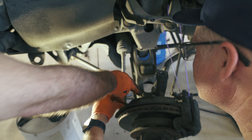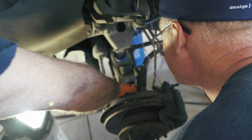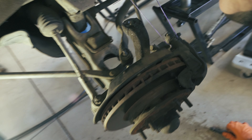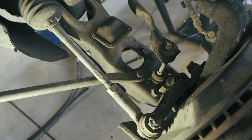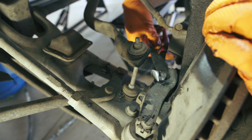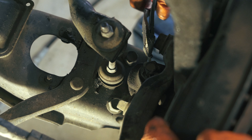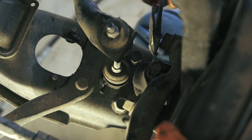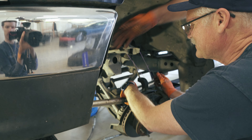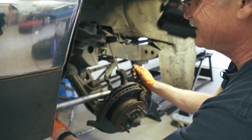Let me get an extension. So this arm is attached and has a spindle going through it, but it's really tightly wedged in there. We have to use these forks to separate it and force it down. When it's all done you'll be able to see exactly what we were talking about as far as how the spindle fits in there.